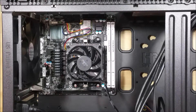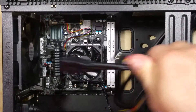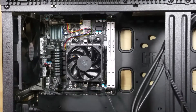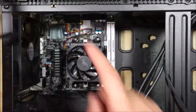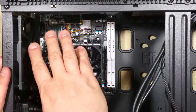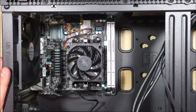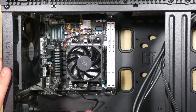We're up for the final video in this installation series of this Mini-ITX build. The next thing we're going to do is connect everything to the motherboard: all the front panel connectors, the rear fan, our SSD, and all of our power supply cables onto the motherboard. This is a little bit specific to the components you have based upon the motherboard. If you need to find where things go, always use your user manual — it's a definite benefit.